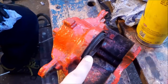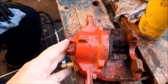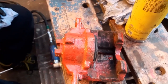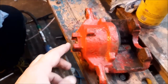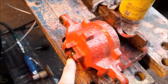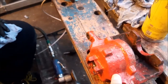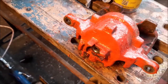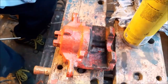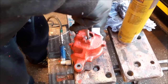There are a couple of ways you can get the piston out. One way is to pump the brake pedal when it's still connected, and that will gently push it out, but it could end up being messy. Another way, which we often use, is compressed air — you put the compressed air into the hole where the brake pipe goes in normally. Or what we're going to do is push it out with a punch. Normally you're only doing this if you're changing the piston anyway, so you don't have to worry about damaging it. But you do have to watch that you don't damage the thread.